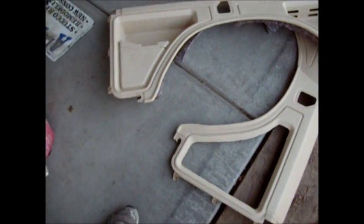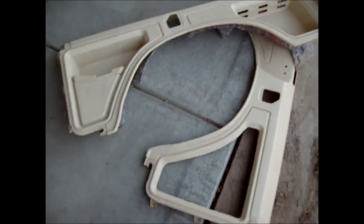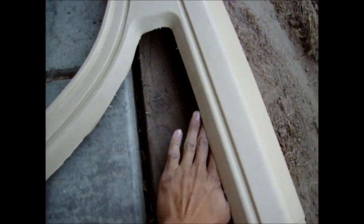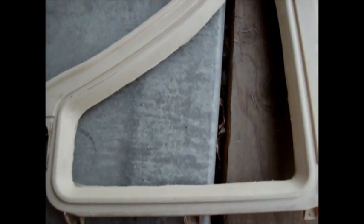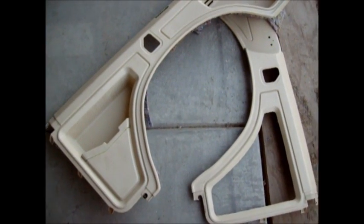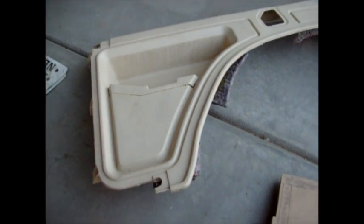So what I did was just put in MDF for the baffle and to take up that space in there. And so when you get it all together, MDF is going to sit like right under here with my hand, and I'll probably carpet it, and then the speaker will be in the middle. So that's what I plan on doing. So I'll show you the baffle here in a second. Here's baffles I made with the MDF. A lot of little cuts to try to get it big enough so that when I cut out the outline that no gaps show, and it actually turned out really good.